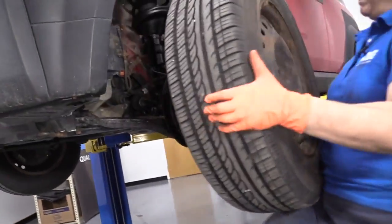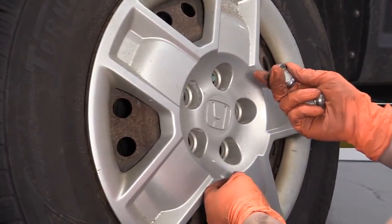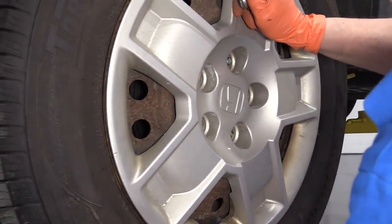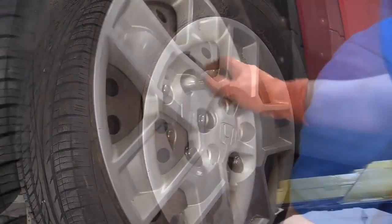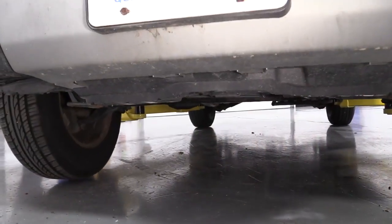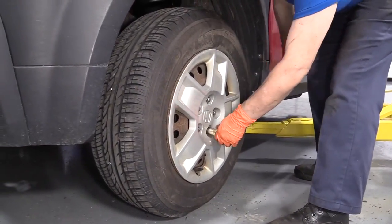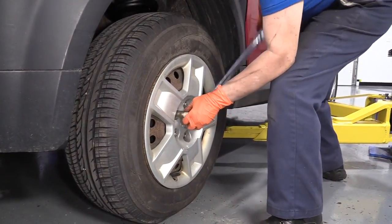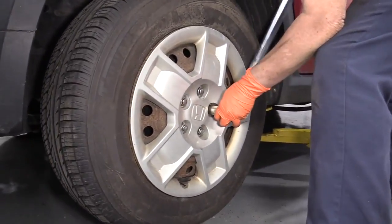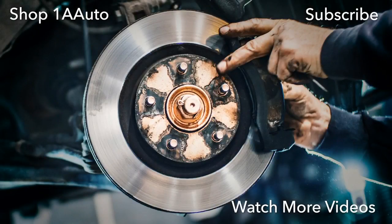Now I'm ready to install the wheels. I'm going to mount the tire again. Grab your hubcap because this particular Honda does not have extra wide cutouts for the lug nuts. Set the rim up on the hub and put your lug nuts on. I've got the weight of the vehicle down on the tire and I'm going to torque up the wheels — the wheel torque at factory spec is 80 foot-pounds. Thanks for watching. Visit us at 1AAuto.com for quality auto parts, fast and free shipping, and the best customer service in the industry.